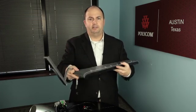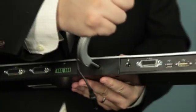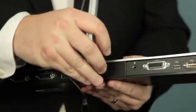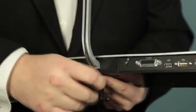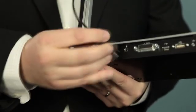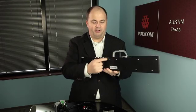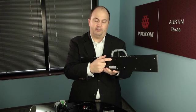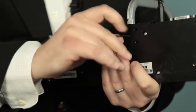The first thing you want to do is take the base unit out of the box along with the vertical microphone array. You'll notice immediately that there is a hole right in the back that allows you to plug the vertical microphone array directly in. There is a small mini stereo jack that you'll plug into the base unit, and there's a screw on the very bottom that you'll want to turn just a couple of times to tighten up the vertical array.